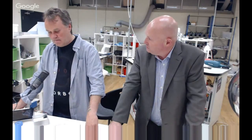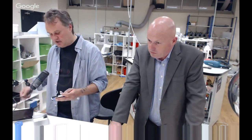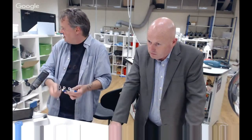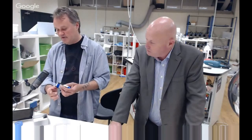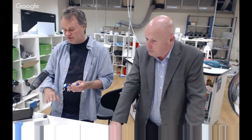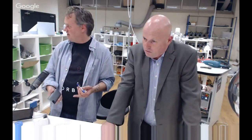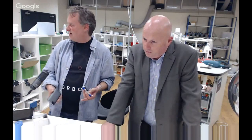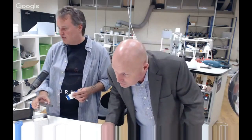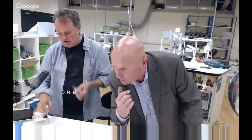What happens with lithium batteries is that as you charge them, they take less and less charge. The depth of them, or how much charge they're holding, tends to reduce and reduce. What that effectively means to you as a customer is that you plug it in, it seems to charge really fast and it doesn't last long. So it's saying 100%, but it's lasting 3 hours instead of saying 100% and lasting 12 hours. In the event of a trickle charge, that's not really an issue for us because we're constantly doing that.